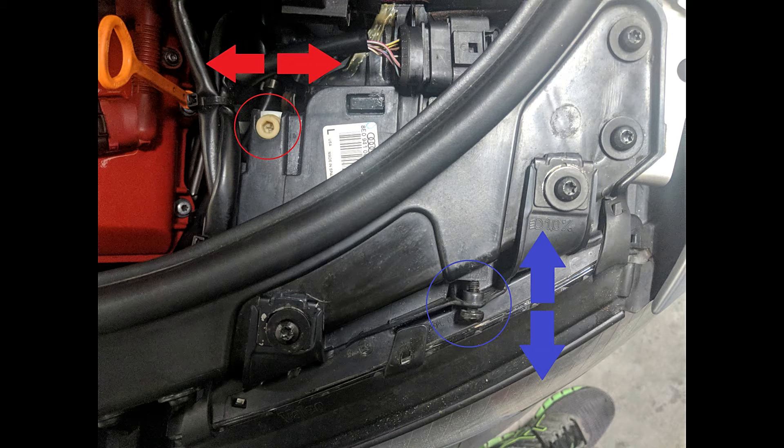In this still image, you can see arrows all over the place with some circles. The red ones are for making adjustments to the left and right, and the screw with the blue circle around it is for up and down. I had to loosen the left and right screws near where the blue circle is in order to push those tabs back a little further to raise the actual beam. This may not be necessary for you, but if your beam is sitting too low, that's what you'll need to do.